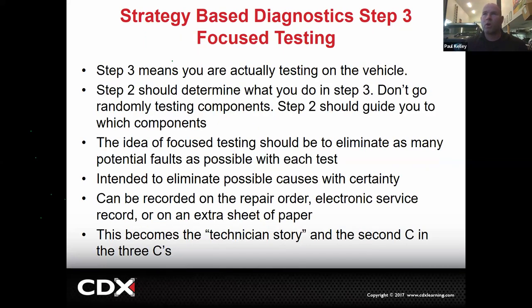Okay. And then when we get into focus testing, that's when we're actually really on the car, right? So I kind of blended two and three. Two is researching what it could be, and three is actually doing the test, cracking the bleeder loose, measuring with a meter, these types of things. You should be eliminating as many potential causes with each test. So if one test is going to eliminate three possible causes, then I do that test first. Makes sense. Just trying to take all the possibilities and get it to the fewest possibilities in the quickest amount of time. Additionally, as you're doing this, you need to record it on the repair order